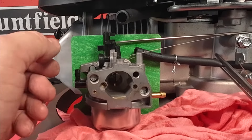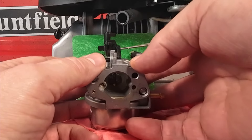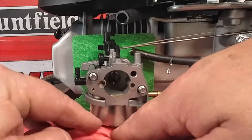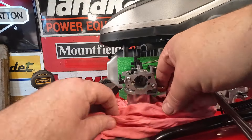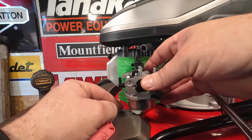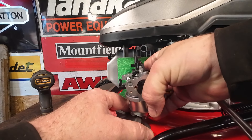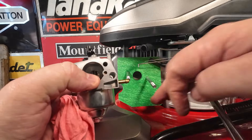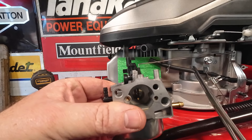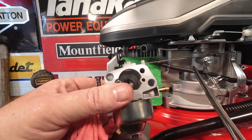There's about three threads out the other side, but that will allow you to open the governor arm all the way up — and then your governor arm will just come straight up and out. Once the governor arm is off, push back that little tiny green gasket. Then we should be able to slide the carburettor past that plastic piece — and there's your carburettor in its entirety. Let's get it cleaned.